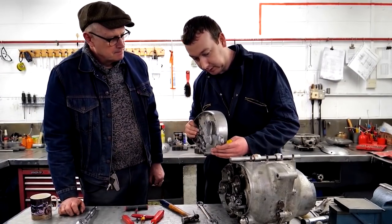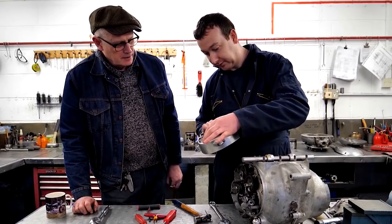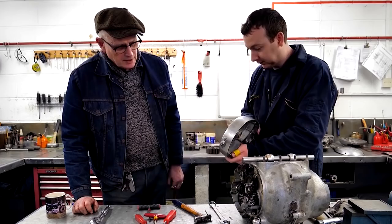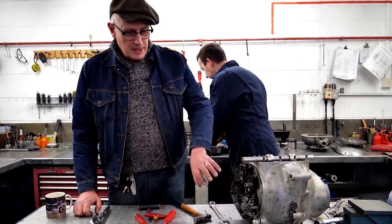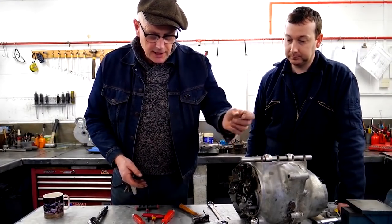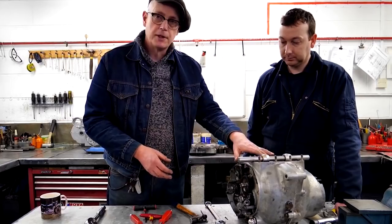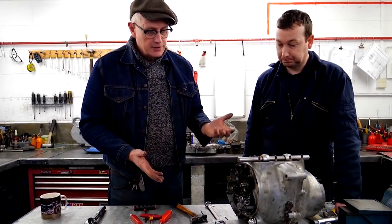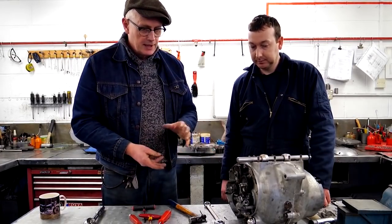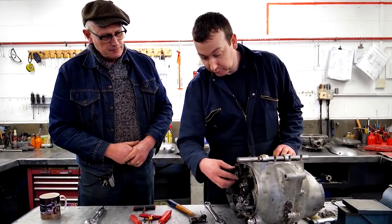If the customer is having the needle roller conversion, that converts it to having an end feed through the crank to the bronze bush. They'd have a block welded onto here and then it would be drilled through to feed into the end of the crank. This is perceived as the Achilles heel of these engines — the main bearing on this side is a plain bush as opposed to a ball or roller bearing. Oil is pumped into the outside of that bush, then goes into a hole in the crankshaft and feeds the big end bearings. But what tends to happen is the bush wears, and then some of the oil, instead of going through to the big ends, just sprays out. The conversion runs an injected feed directly into the end of the crankshaft, so the oil has to go to the big end bearings where it needs to be. We'll see what state that bush is in when we get down to it — I'm expecting it to be worn; it usually is.